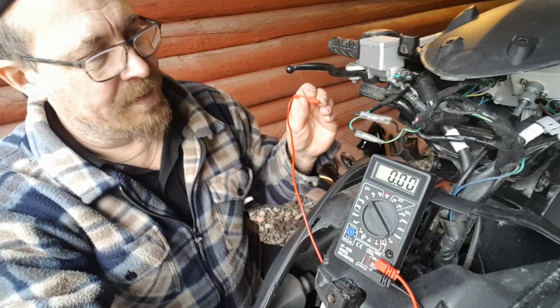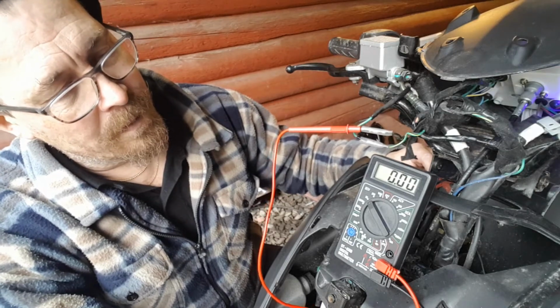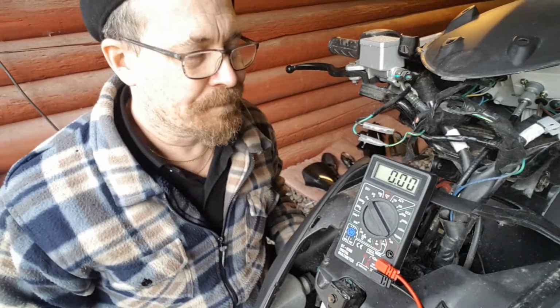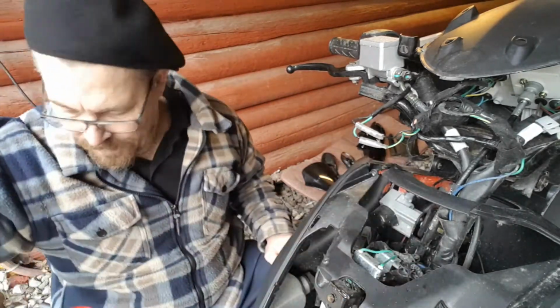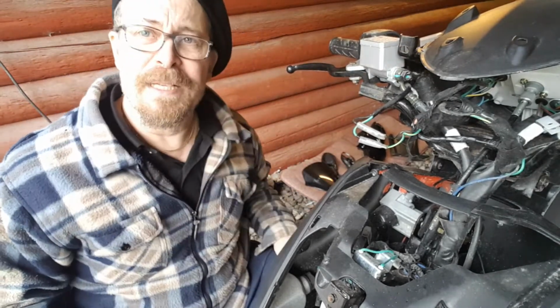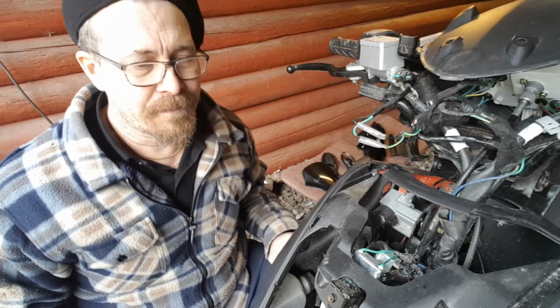We want high when the engine is on or ignition is on. Let's say that it's running. I have zero right. I'm just going to double check here. So this is actually ignition, I guess. So this one is going on the ignition. Now I'm gonna cut this wire. No, I'm not gonna cut it. I'm gonna do the switch feature, and I guess it's pretty cool, right? I would need a relay, so it will be self-latching from the ignition once you gave it a pulse, in order to start the low beam.